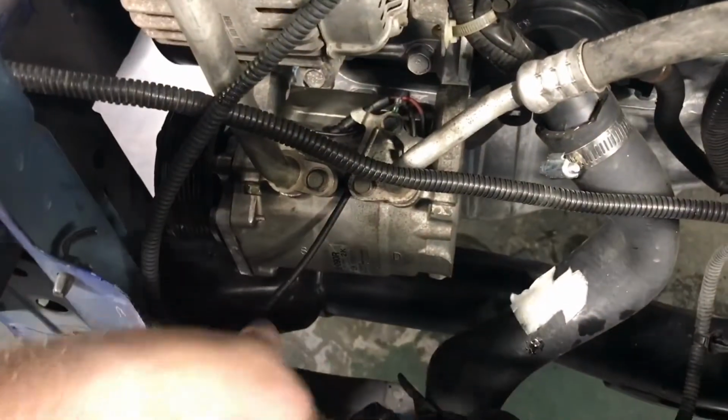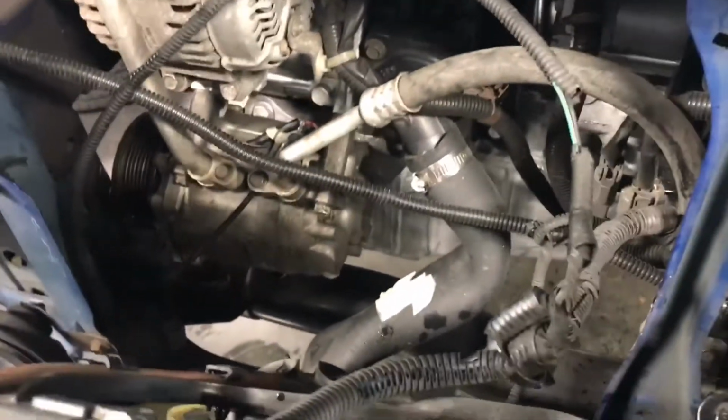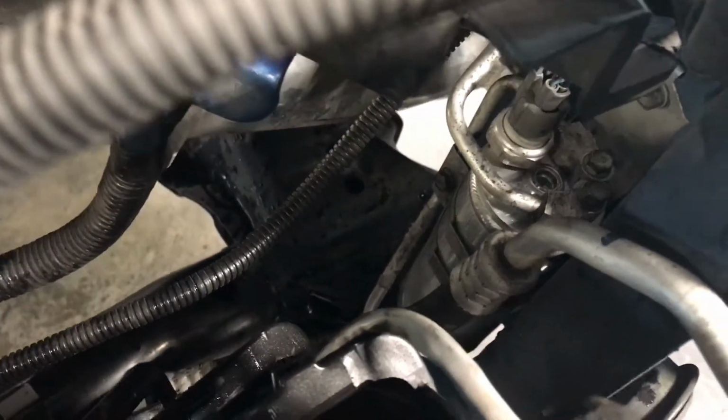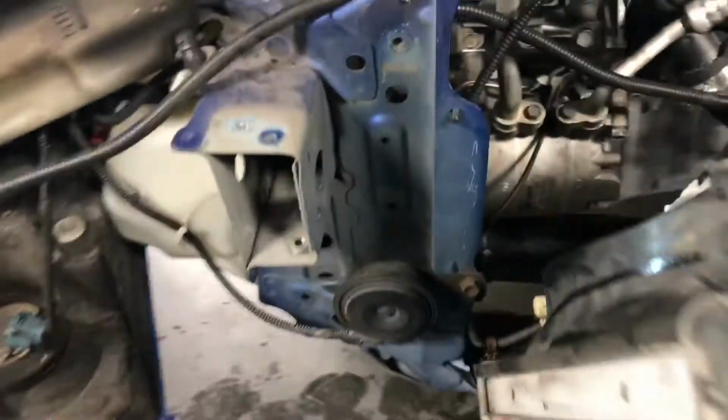All right, well, I made a big mess. Coolant, a bigger mess than before. Got the compressor in there. I would say the hardest bolt is going to be the right hand lower bolt to get in. Even with the lift, it was just kind of a bear to get in. See here, everything's plugged up. I got my new dryer in there. New O-rings for those lines. I hope the front one's lined up because I kind of just guessed. And right now it's just assembly time.